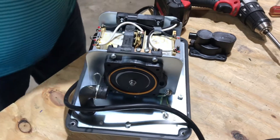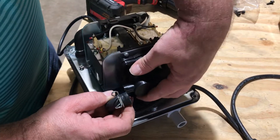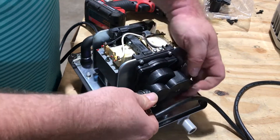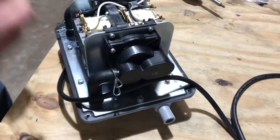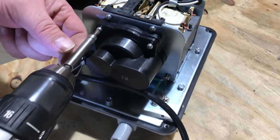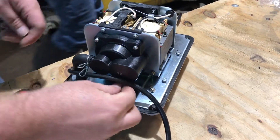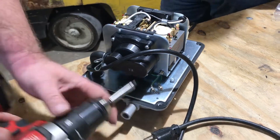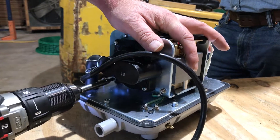Go on this other side here. Now what you do is you take this — this is your chamber block. Sets on over here, and this sets over here. So there's your chamber block on there. Then you take your screws. You don't do it too tight — you don't want to crack this. I recommend you do it with a regular hand Phillips head screwdriver. Otherwise you can crack that and then you have to buy another kit. It's just that we've done this so many times that that's not going to happen when we do this.